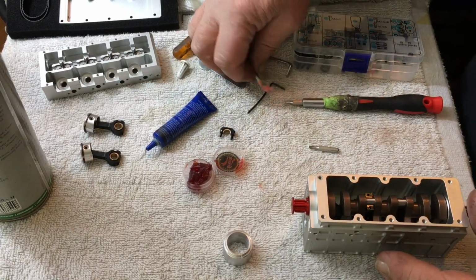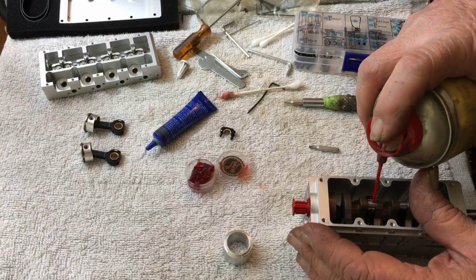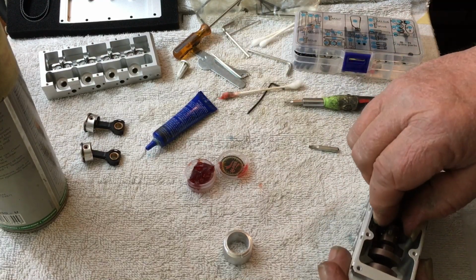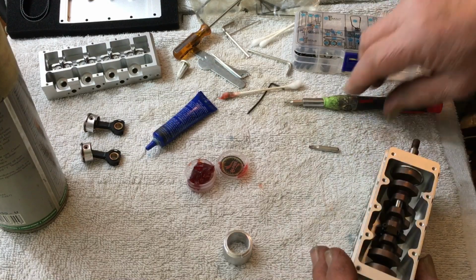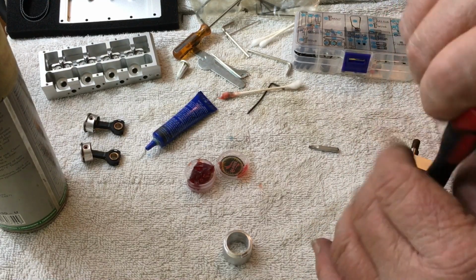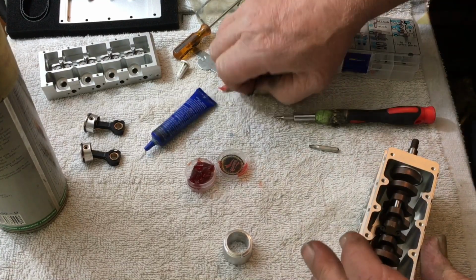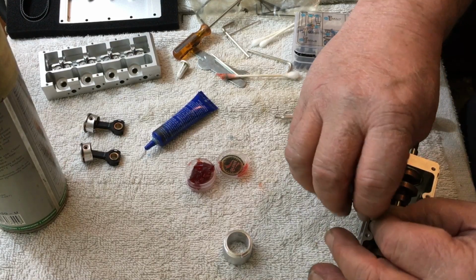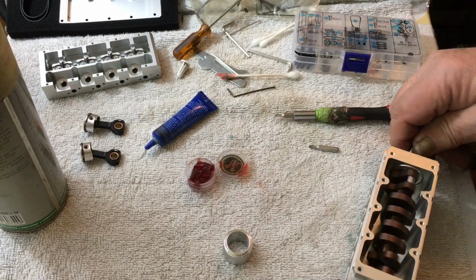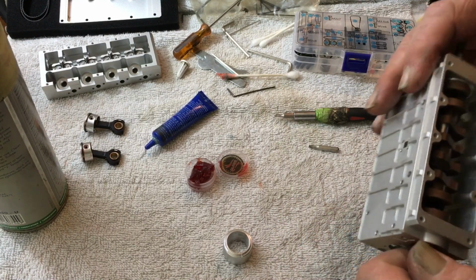Now, get the grease. HHS. Now my rod cap. Mark forward, like so. You already got the Loctite on it. Everything's good. One, two. Now it's getting stiffer as we go, but always give it a little turnover by hand. That way you make sure everything's cool.